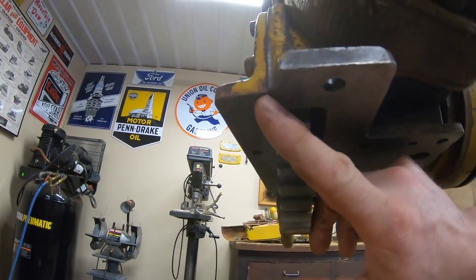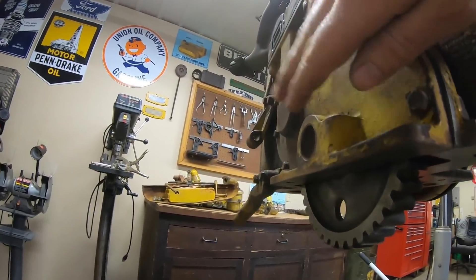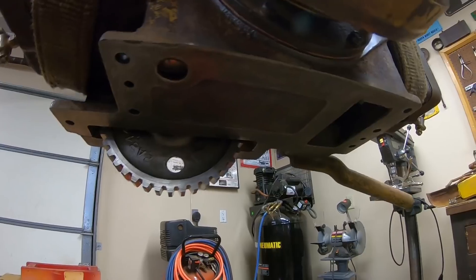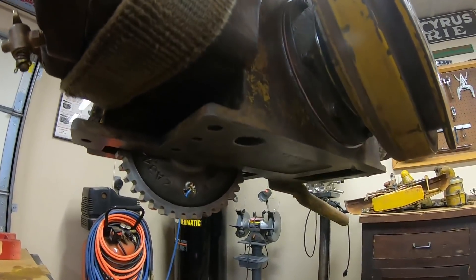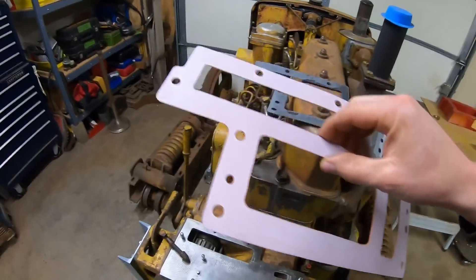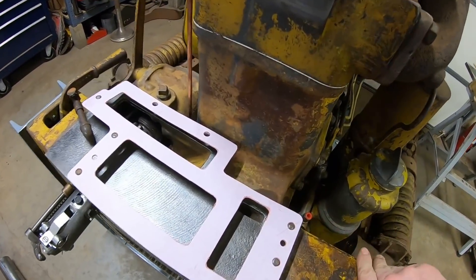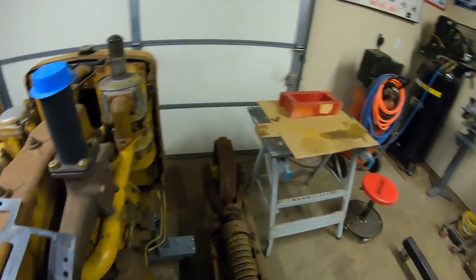And it's got nothing to do with those T-joints for that front cover — they are all good. Besides, everything locates so tightly on that idler gear hub shaft that that's not causing the problem. So two options here: the first one that we're not going to do is strip this engine back down to have this base surface milled. We're not going to worry about that, at least not right off the bat. What I'm going to do is — I made my own gasket, slightly thicker, hoping it's going to have some more compressibility than the CAT factory gasket did. Plus we're going to back it up with a little bit extra sealant in this whole area, put it all back in, and see what happens.